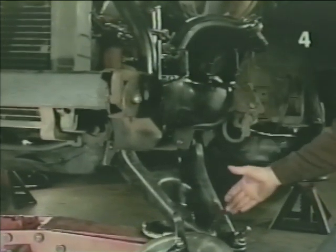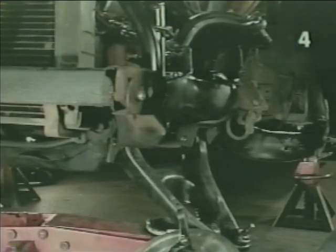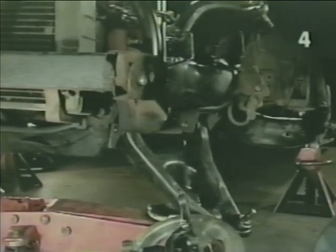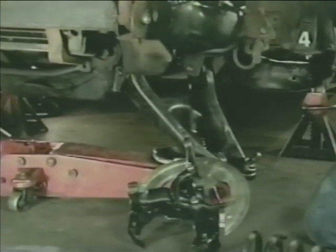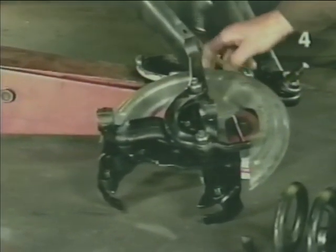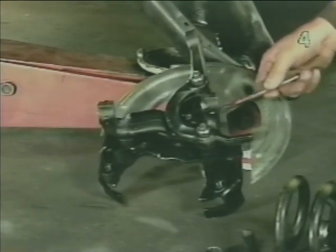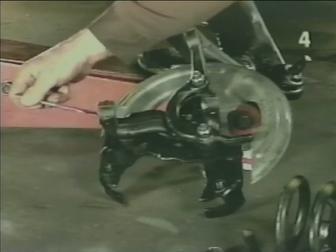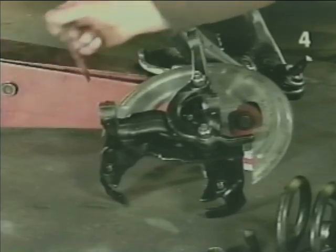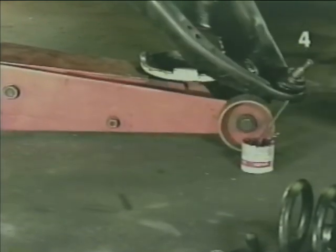With the upper and lower control arms positioned in the chassis, you can now reinstall a coil spring. To do this, we want to first make sure that our spindle is prepared and close at hand. To prepare it, we want to grease the tapers for the lower and upper ball joint. This will assure us that they will pull in correctly. Keep that nearby.